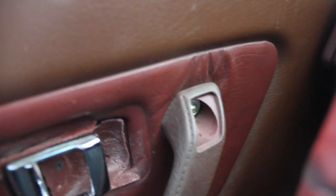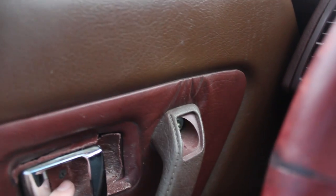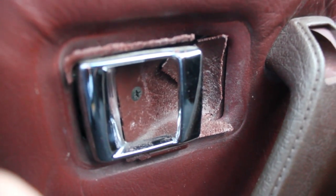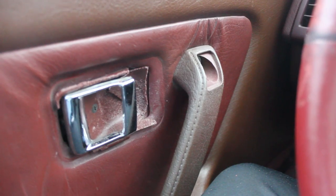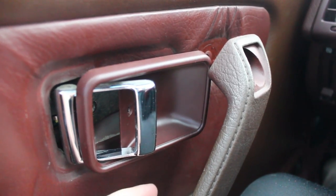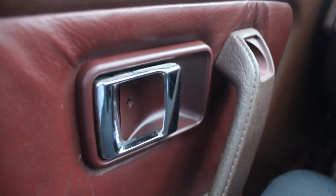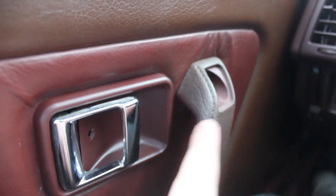Here is the little plug that comes out — you just pull it right out, and as you can see there's just a little screw back there. You're going to take out this screw right here. They are two different sizes, so I did have to use two different screwdrivers, but that's fine. What you do is pull this handle forward, then act like you're opening the door, pull this up, slide it on through, and it clicks into place. Now you just have to replace this screw and this screw.